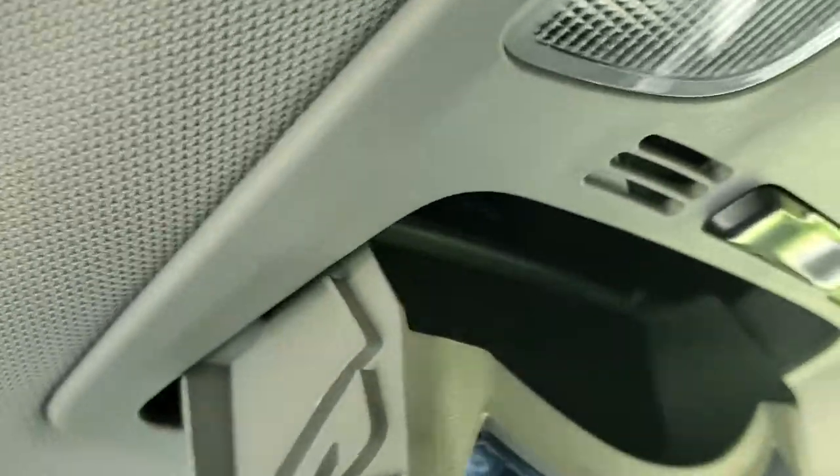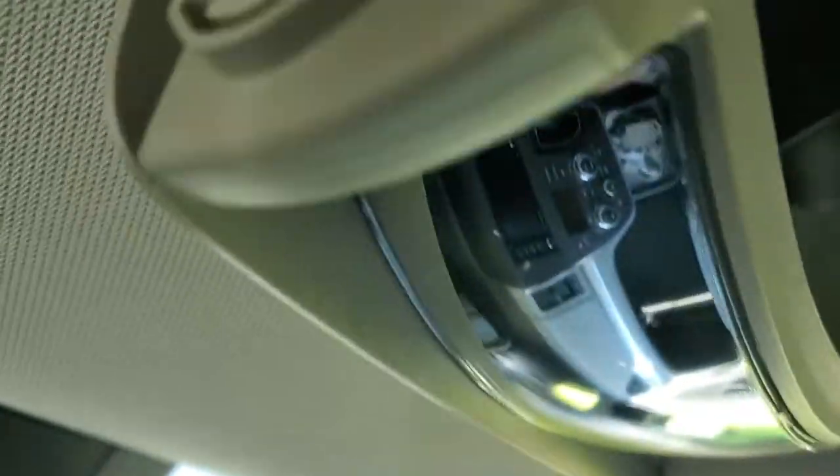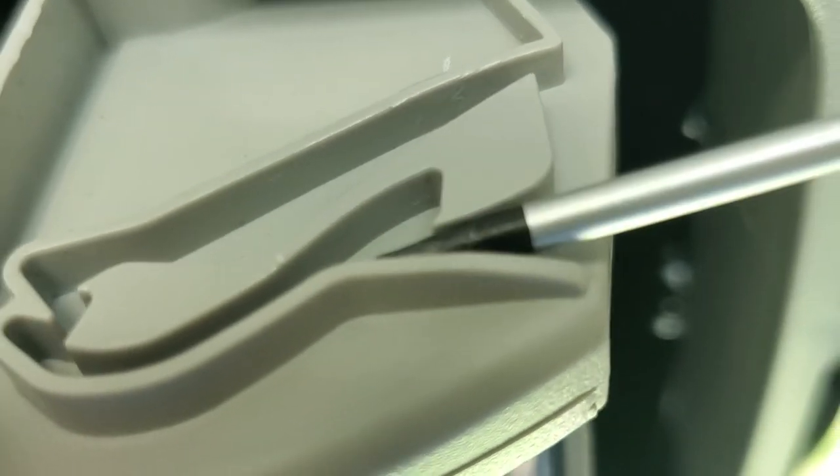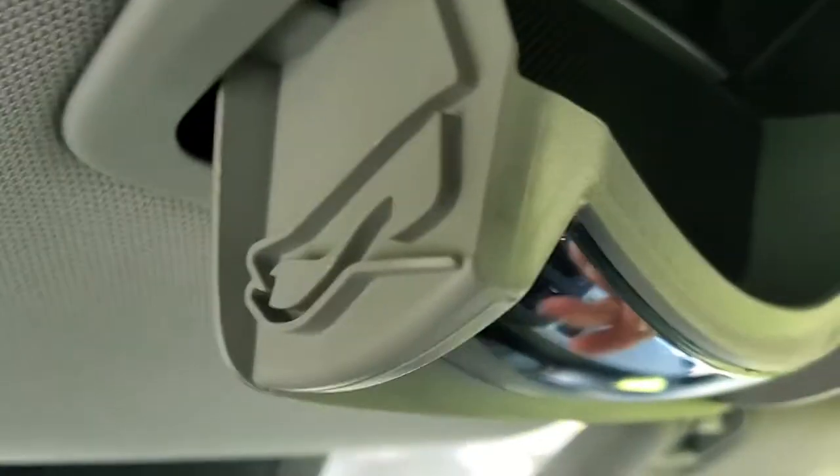First I'll demonstrate what happens: inside here is a rocker pin that goes back and forth as you go in this track. So when you close the door on this — pretend that this screwdriver is the rocker pin — when you go and it gets hung, it gets hung right in here like this. So you need to release just a little bit and push it forward, and then it has to come out forward so it'll release.